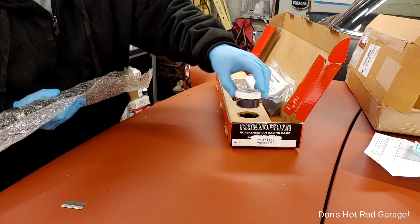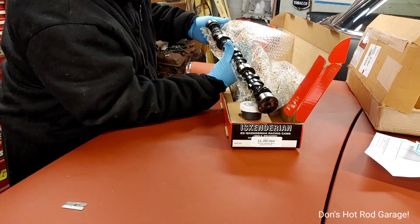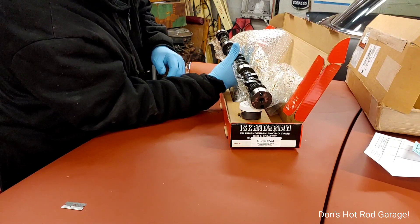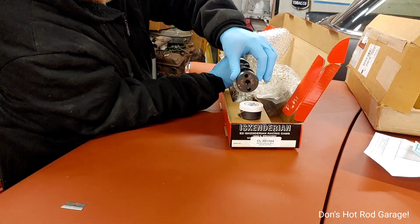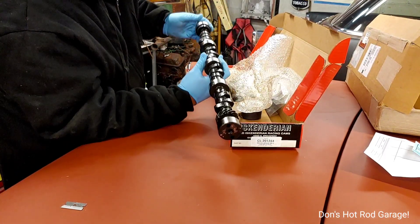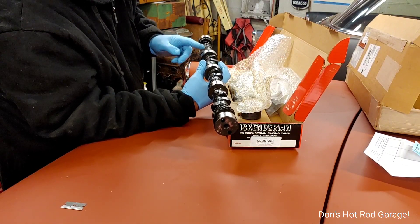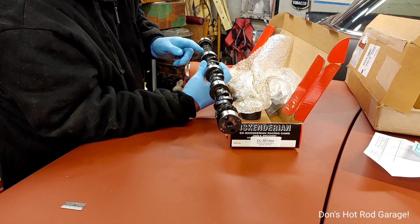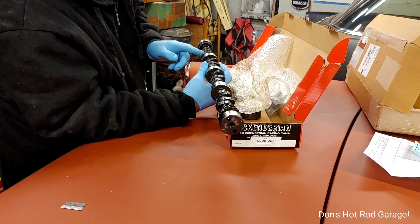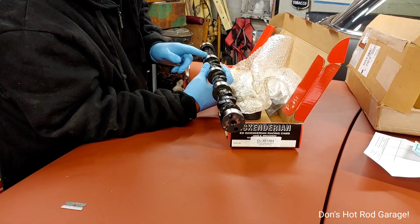Now this particular stuff I don't want to get on the primer because it'll soak in, but they've got it lathered up in some form of gear oil. This is one of the few companies — you wouldn't believe it — but this is one of the few companies that actually hardens its camshaft. A lot of manufacturers nowadays don't harden them; they don't put them through the treatment process, and you have a lot of cam failure because of that.